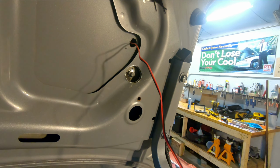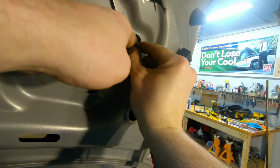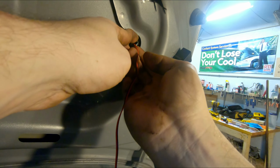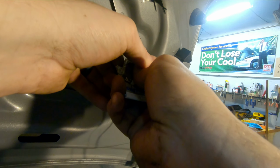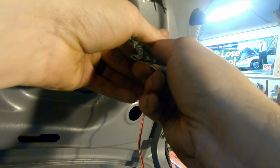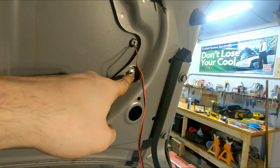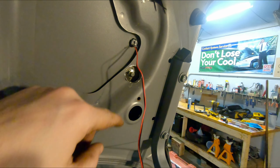Alright, so the last thing I'm going to do before we go ahead and do the big reveal on this is we need to work out this third brake light wiring. So I'm going to go ahead and do the same thing with a small piece of silicone tubing that we did on the top. And we'll fill that with some silicone just to create a bit of a seal there. And as long as we're on the topic of sealing things up, I realized that we're doing all this sealing around these other holes, and yet there's no sealant for the bolt holes. So what I'm going to do, off camera just because it's going to be relatively boring, is take each one of these bolts out, put some silicone around the head of the bolt, and then put them back in, tightening the bolt down around the silicone, and that should seal up all the bolt holes.